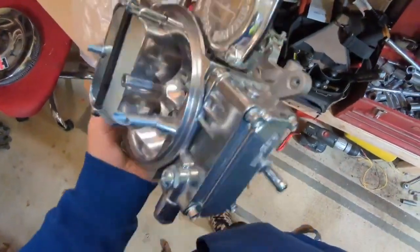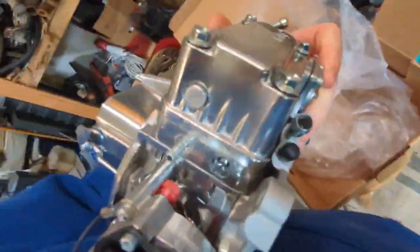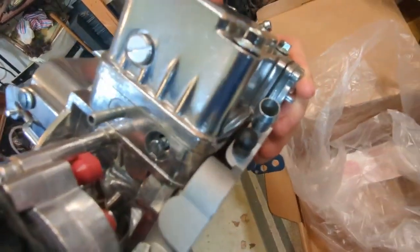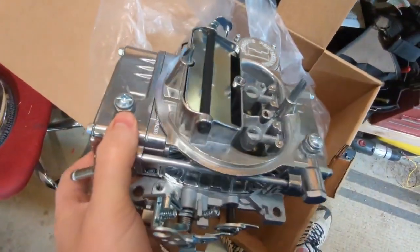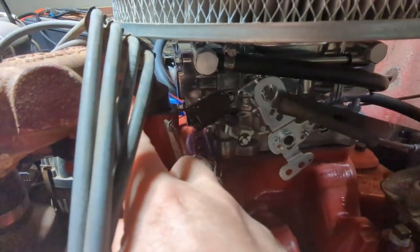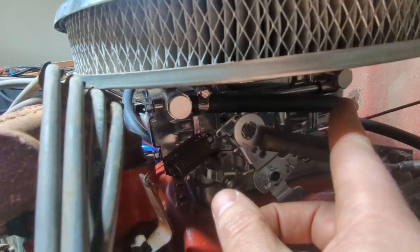So to conclude, the Holley refurbished products, incredible. Ran out of the box. The way they have it calibrated from the factory is perfect. The only thing I did was turn the fast idle back down a little bit. I think from the factory it's set to like 1200 to 1600 or something like that is the range they aim for. I wanted a little bit lower. And also change the choke duration for how quick the electric choke comes off. The idle mixture is just spot on.